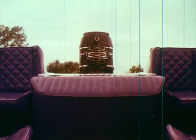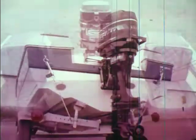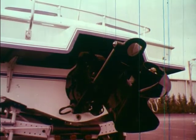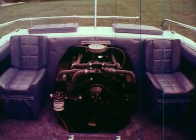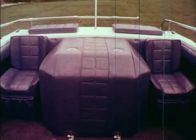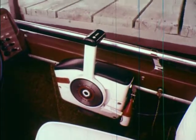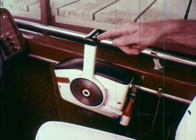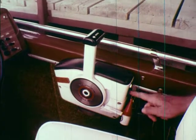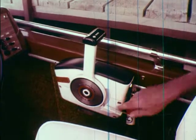Modern powerboats have two basic types of motors. This one is called an outboard. If it doesn't have an engine hanging on the transom, it is an inboard or inboard-outboard, sometimes called a stern drive. These two types have the engine inside the boat in a closed compartment. Electric start boats of this size are operated much like an automobile, but the throttle and the gear shift are combined into this single lever control. Mounted there also are the choke, the key starter, and a fast warm-up lever if it's an outboard.